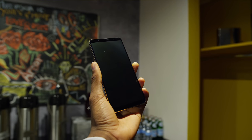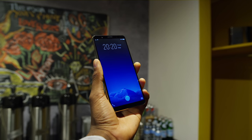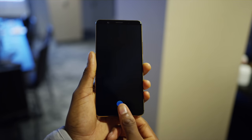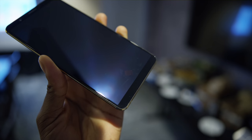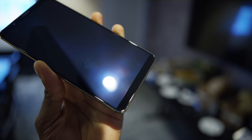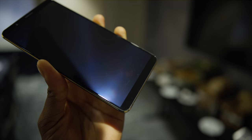And then there's the fingerprint sensor. This is a fun one since most phones have shrunk their bezels so much already that you don't have room for them at the bottom anymore, so they've moved to the sides and more commonly the back. But a lot of times you still want to use it when it's flat on a desk. So you have the option of an in-glass fingerprint reader. One of my latest videos goes over a Synaptics sensor that puts an optical fingerprint reader underneath the display glass for OLED displays. So you can shrink the bezel all the way to zero and still have a front-facing fingerprint reader for unlocking your phone.